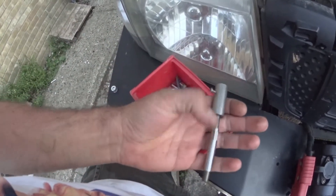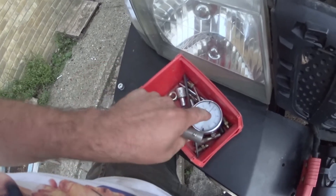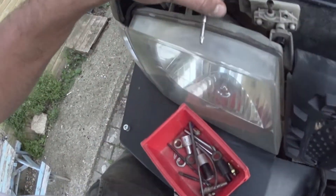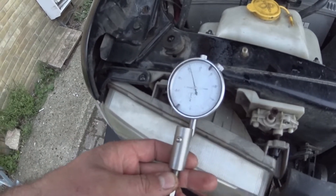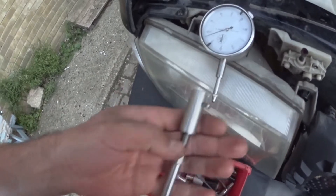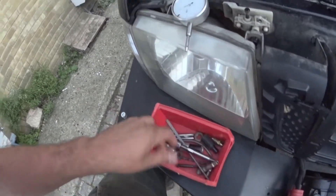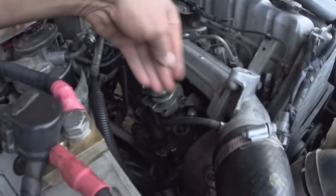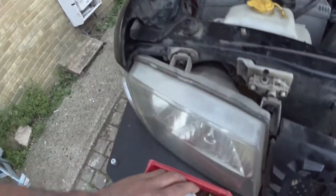Basically the adapter will have a little body and come out to the side where a dial gauge goes. You put that into the pump — there's a rod — and I've made one so that goes in there. That measures the amount of travel the plunger in the fuel pump is doing.